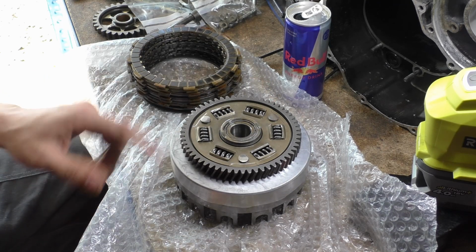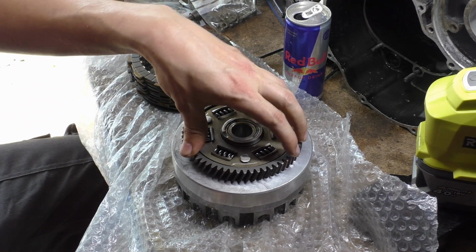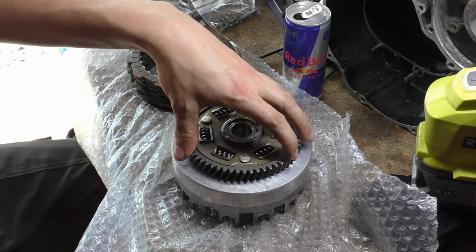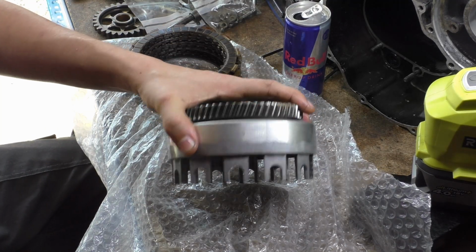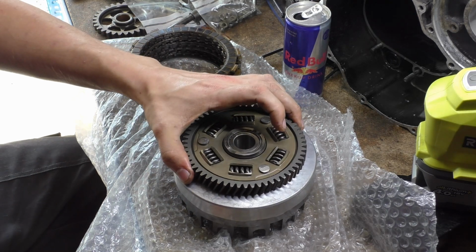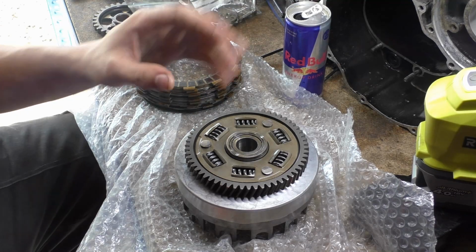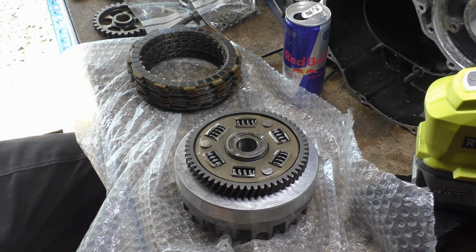The reason why is the clutch basket is this aluminium section here. This gear is the second half of the mating pair for your primary reduction, and as you can see, with slippy hands, it's a helical gear. Why helical gears? Helical gears are quieter. I'm 3D printing some teeth so we can look at the profile, involute gears and how they work, pressure angles and so on.